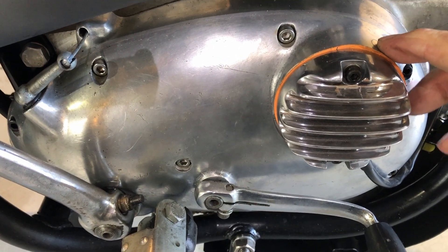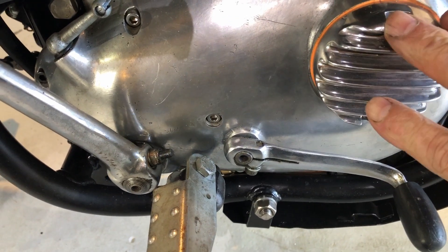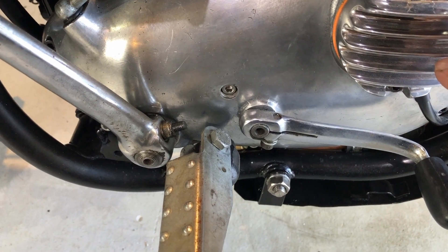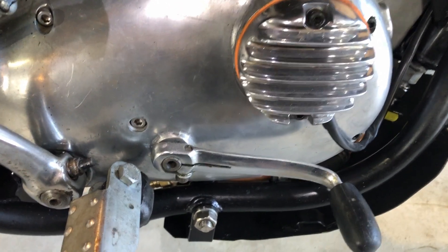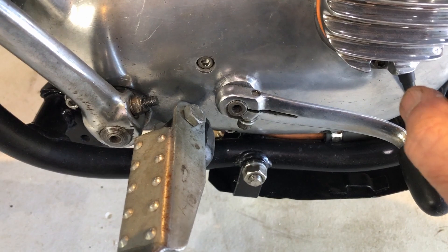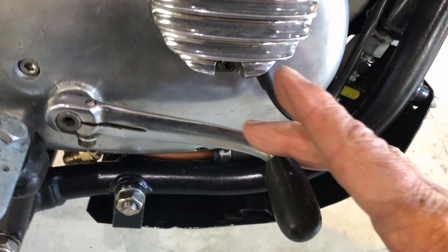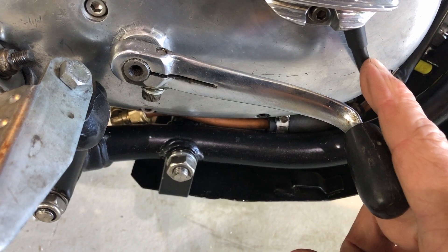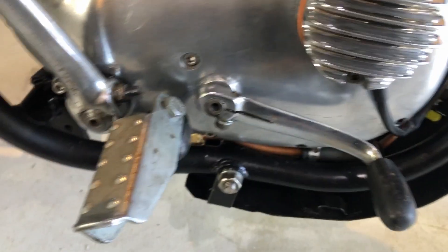The original cable for the points came in at the top here, and when I got this bike and took the original chrome plated tin cover off, it was actually full of water - it had destroyed the advance and retard unit and quite badly pitted the points cam, so they were scrap anyway. CDI went in there. If you get this deep finned cover you can manage to get the plug and cable with the cover on quite neat and tidy, plus I filed a half-round slot in the bottom of the casing to bring the cable out through the bottom.